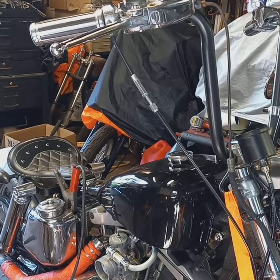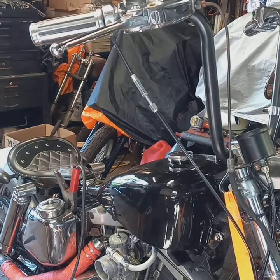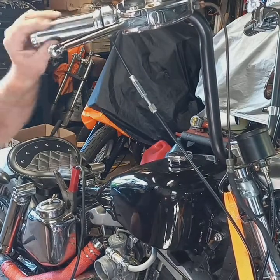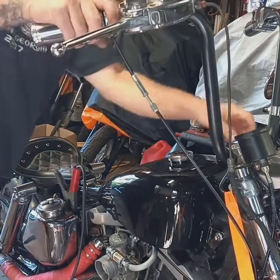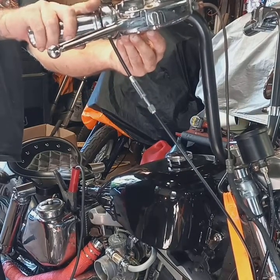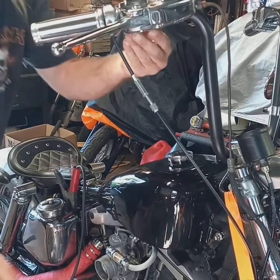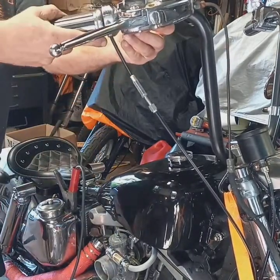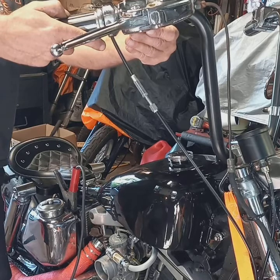Still doesn't want to start, so I'm going to give it a little, and I cannot emphasize enough, very little shot of some starting fluid to see if she'll pop off. Not recommended. This stuff is not just flammable, it is explosive. So let's see what that does. Choking a bit. God, that starter sounds horrible.